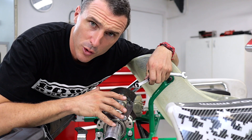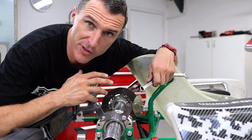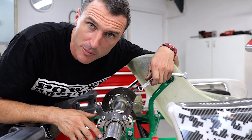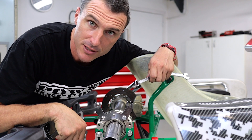The first thing you're going to want to do is remove your wheels and hubs and the sprocket carrier. On this one I've also removed the exhaust so I can get to the bearing hangers a bit easier. It's a fiddly job to get to all the screws — you can do it with all those bits on, but I find it easier to remove them first so I can get to all these bolts nice and easy.